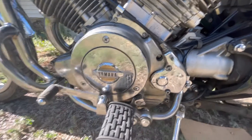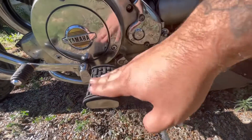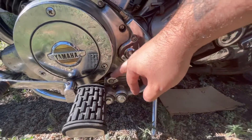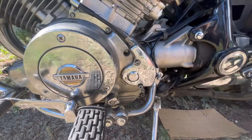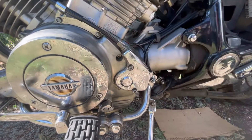So that didn't work. You're going to have to take off the foot peg — the whole assembly. You might not need to take this part off but it's probably best to do that. Just make sure you take pictures so you can put it back on properly. You're going to take this off to be able to get rid of the clutch cable and that will make things easier.